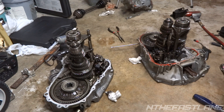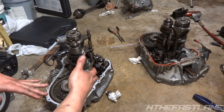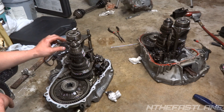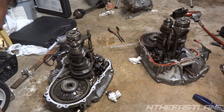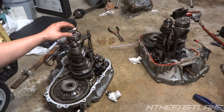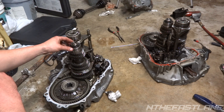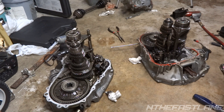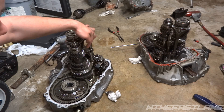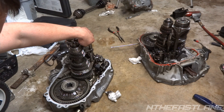If we want to calculate our gears, we've got to first find out which gear to look at to tell us what transmission we have. The first one is fifth gear right here - you have your main and your counter gear. For an LS transmission it's going to have 25 teeth on the counter, so you have to count the teeth on this gear and then count the teeth directly behind it. I got 35 teeth on this one and 25 teeth on this one.